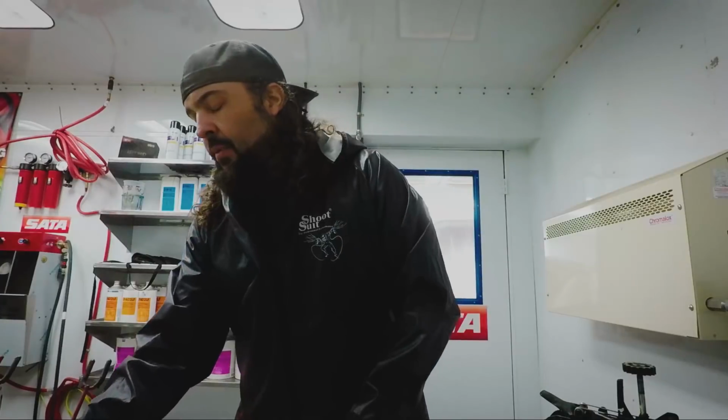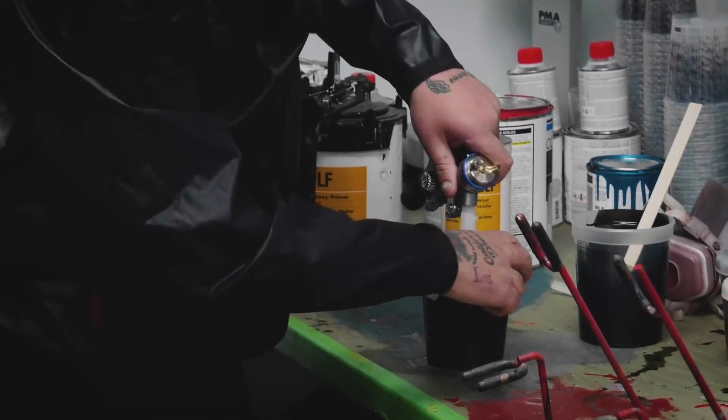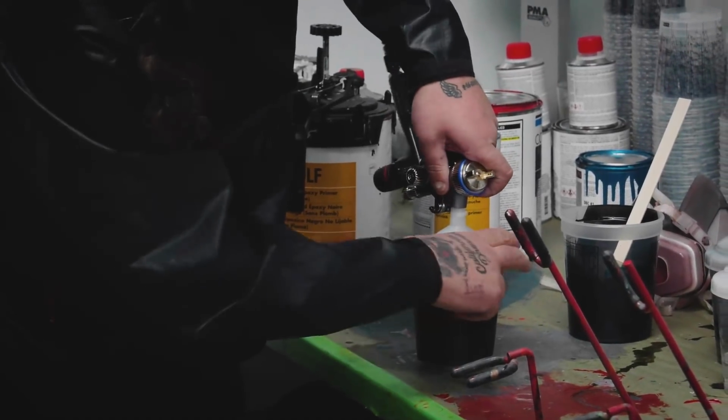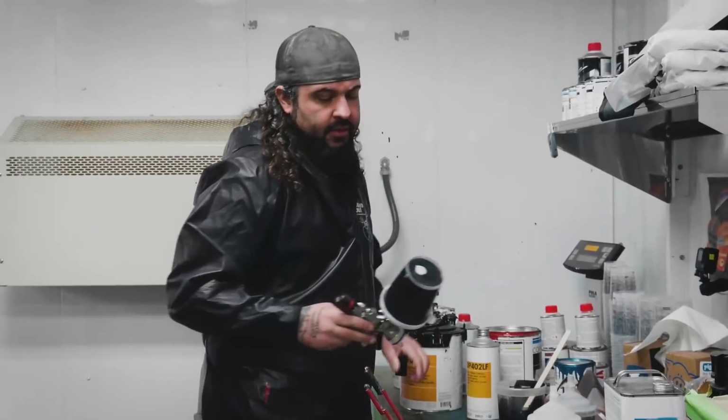So this is just the etch primer. The regular primer that we use is actually a high build primer, and that's what goes over Bondo. This etch primer is strictly meant for going over bare metal. High build just means it's super thick, and it's three or four coats, and it'll have everything covered, and that way we can make the car straight.